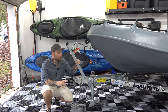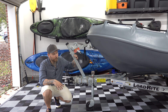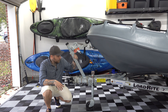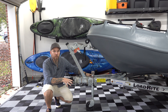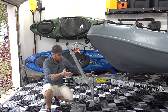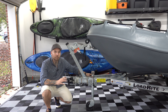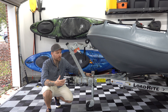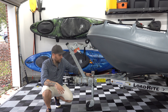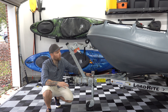To make this work, I did have to move the tongue jack behind the bow roller support — otherwise it would be connected to the swing portion. This buys me as much real estate as possible. I can fold more trailer tongue away. I ended up cutting about 17 inches off the total length of the tongue since I simply don't need it, but it opens up a whole lot of real estate in the garage. This was the first modification I thought of.